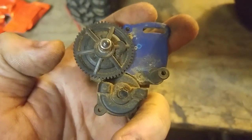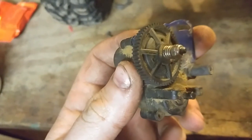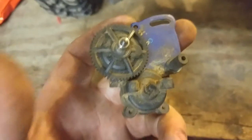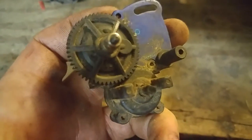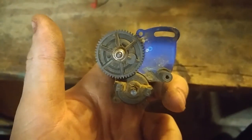When you do that, you'll go ahead and pop the spur gear off, your little slipper clutch off, your little pin that holds the slipper clutch — all that off. You'll pull your motor plate off and then the case should just pop apart. I'll just show you what it looks like when you pull the transmission apart.